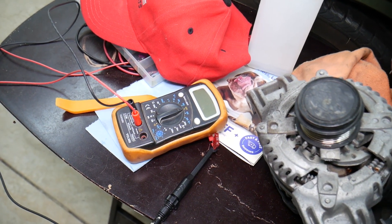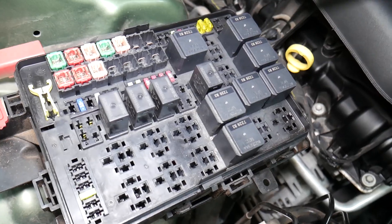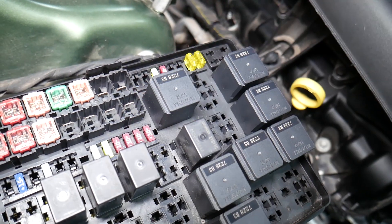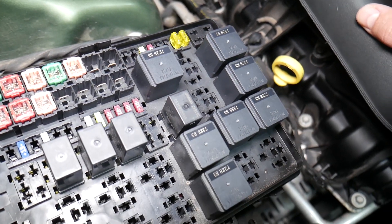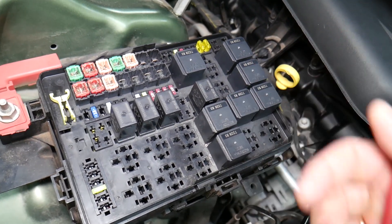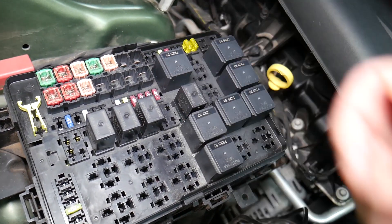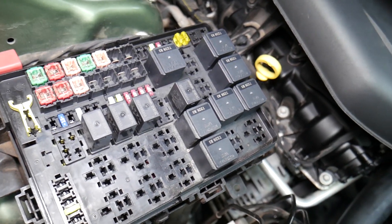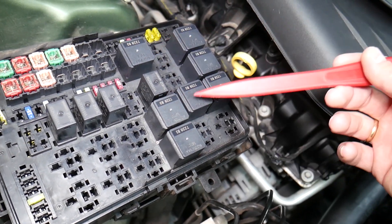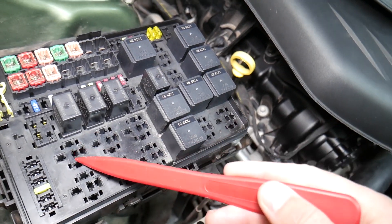It's super important to always test fuses and relays. A common mistake people make is thinking a fuse is good when you can't actually see if it's clearly burned. In that case, you may put the fuse back and end up spending money and time on parts you don't need — all you had to do was test the fuse. We'll put a link in the description on how to test fuses and relays. It only takes a few seconds to find out for sure if it's good or bad, and some relays can be really expensive.